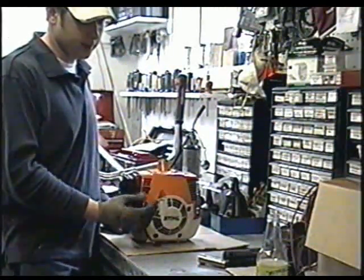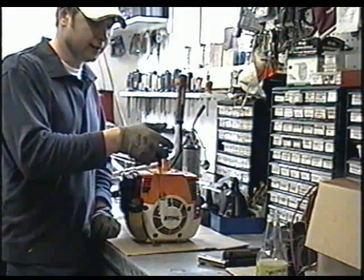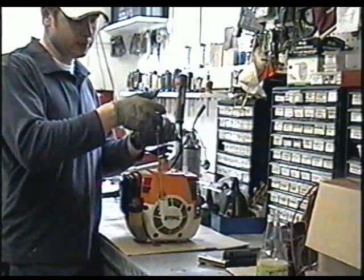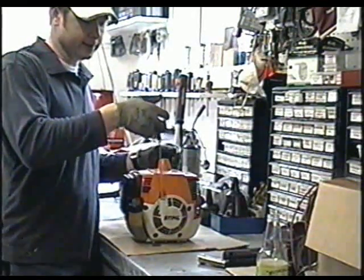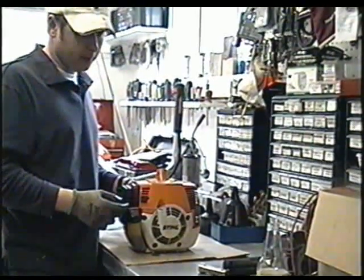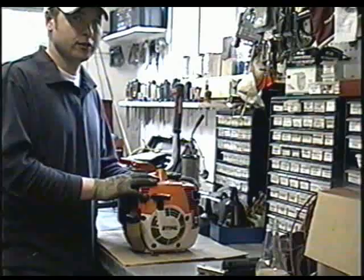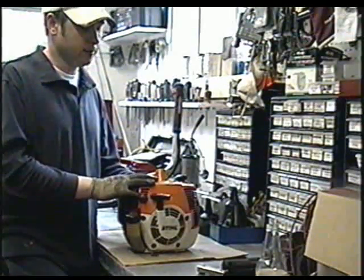Usually, like I mentioned in the previous video, if there's a lot of compression, you can grab the machine and lift the whole machine just by pulling on the cord. But in this case you can't. I've seen smaller trimmers with a lot more compression than that. So I'll take it apart and I'll show you what happens when you run your 2-cycle equipment with no oil